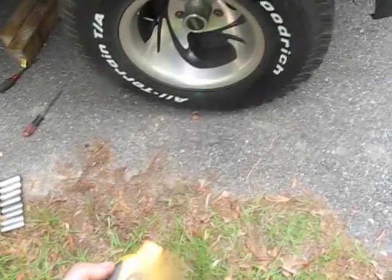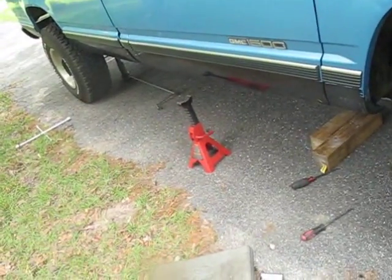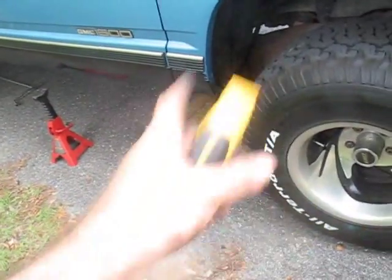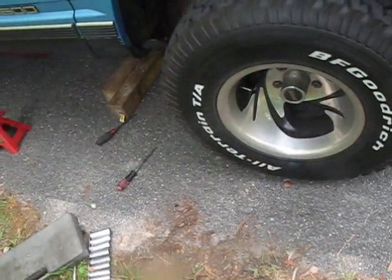So that can tell you something else as well. Just a handy little tool. The back brakes, depending on where you take your reading from, will be a little bit less hot than the fronts. So don't compare your fronts to your backs — compare them side to side. And it should help you out and maybe tell you where you ought to go.